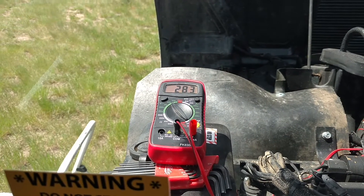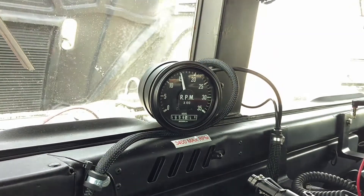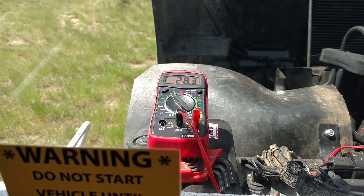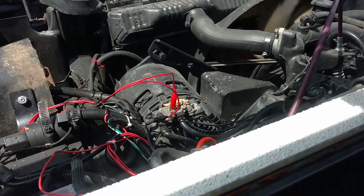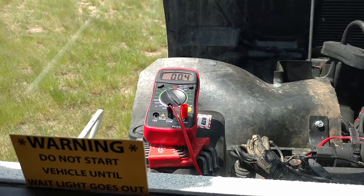When you do this, I recommend having your vehicle warm because you'll want to run your RPMs between 1200 and 1700. You can use the throttle lock located underneath the gauges to lock your throttle in that range. I'm at 1500 RPM, which is close to the middle, and my output voltage has been adjusted to 28.3. This is crucial for maintaining your batteries and electrical system — you want to make sure that within the specified RPM range you do not exceed 28.5 volts but you don't want to be under 28 volts. You want to be in between there.